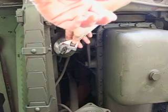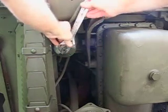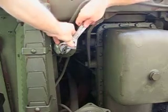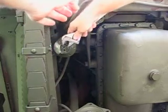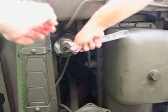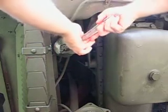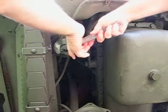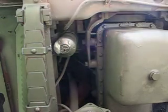If it works, then I'm good to go. If it doesn't, then I've got to replace the fuel filter housing. However, I have a feeling that even if it does work for now, it probably will fail in the future. So this is probably more of an R&D drill, trying to see if epoxy actually does work for sealing up fuel leaks. My dad used to make gasoline tanks out of epoxy and fiberglass cloth, so this is just working off that theory.